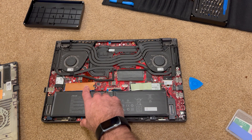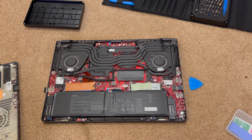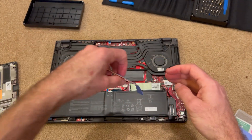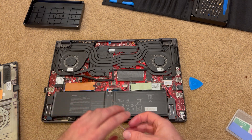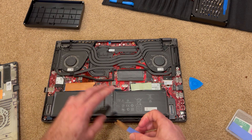The kit has a one millimeter copper piece, and it comes with two different sizes of thermal pads — a half millimeter and a one millimeter. I'm actually using both a one millimeter copper piece and a one millimeter thermal pad. This can be used on any other laptop, by the way, though not all SSDs would require this sort of product — it really depends on the SSD, because some of them run hot and some do not.